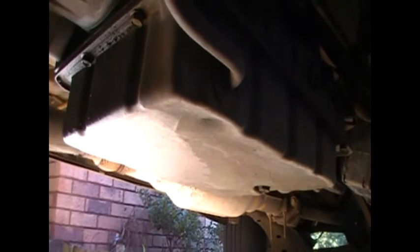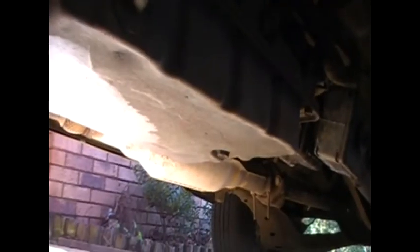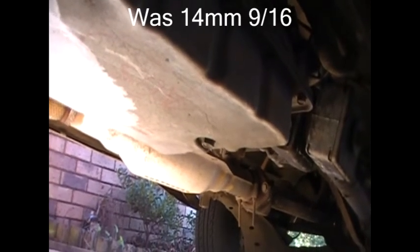I'm going to do it now and I'm going to write down the kilometres when I'm finished so I know exactly when to do another change. I'm not doing a complete change — only a partial change, so about four litres should come out and I'll put four litres back in. I've got a clean container to put it into and I'll measure it to make sure I put the same amount back in. The sump bolt looks like it's 14mm.